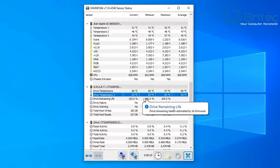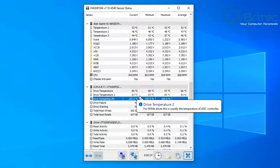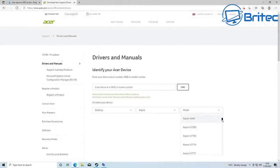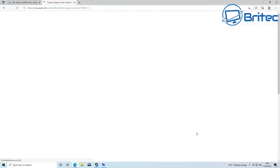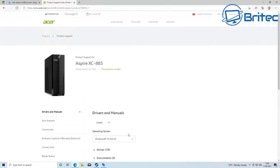I'm going to show you how to troubleshoot and fix this issue. This NVMe drive itself isn't necessarily the problem — it's more likely the board and the machine. I'm going to head over to the manufacturer's website and look at the available drivers. I'll also check whether there are any BIOS updates, since flashing the BIOS can sometimes fix known hardware issues.